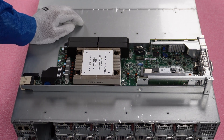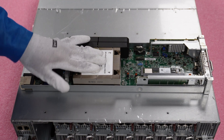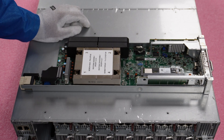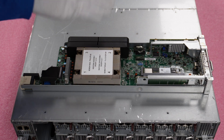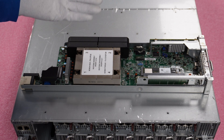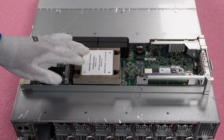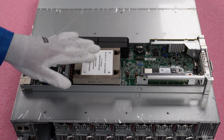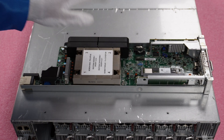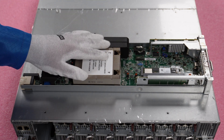Here's a close-up of one of the blades. You can see the M.2 slot, the micro LP for 10 GbE connectivity, and where the Ryzen CPU goes. There are four DIMM slots under these mini air baffles to help with airflow. This is just a great design — being able to put Ryzens into a blade is going to be huge for the hosting industry. With a 16-core processor, you can run 15 virtual machines per node, meaning across eight nodes you can run 120 virtual machines in a 3U chassis.